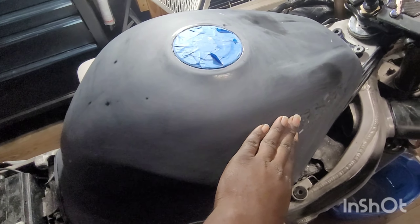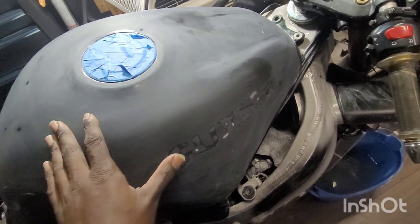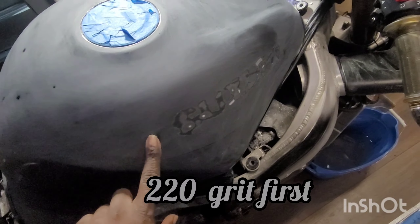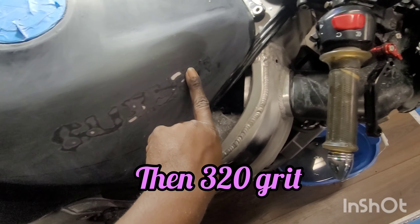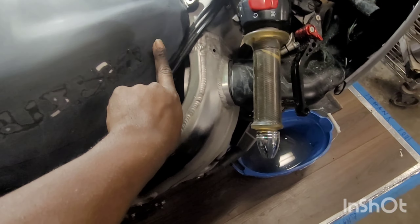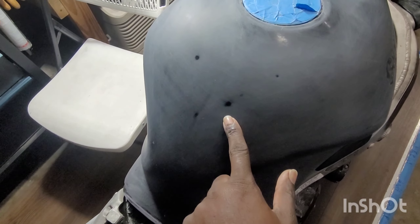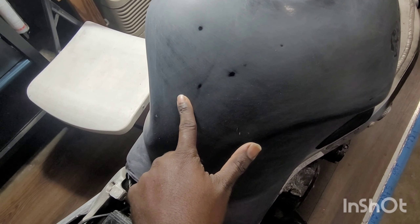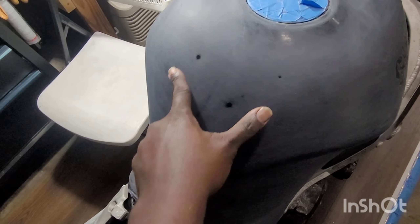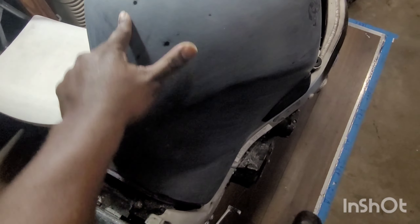These are factory stickers that were painted over — they paint and clear coat them into the panel — so I had to remove them. We already sanded this tank down with 220, then 320 over top of that. Then we're gonna use a little bit of filler right on these sticker areas because I got a couple little spots — it didn't want to come off easy so I had to scrape it with a blade. Same thing here — you can see these spots in the tank, little dots. Maybe he had keys or something, but they're low spots. These are gonna get sanded again and then we'll put a little bit of filler and fill them all in.